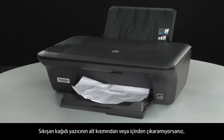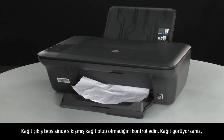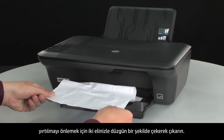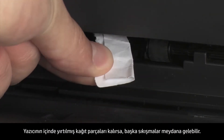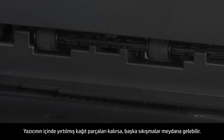If you cannot remove jammed paper from the underside or inside of the printer, then we will attempt to remove it from the front. Check the paper output tray for any jammed paper. If you see any paper, remove it by pulling evenly with both hands to avoid tearing. If the paper tears while removing it, check inside the door for any torn pieces of paper that might remain, as more jams are likely to occur.